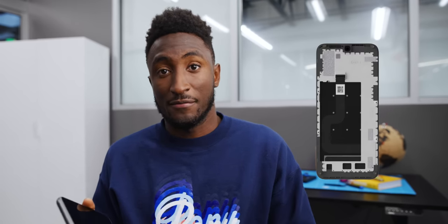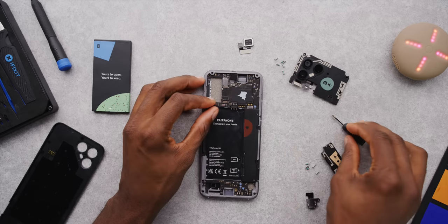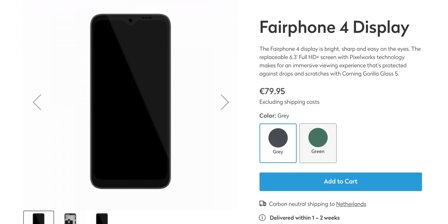It's not like other phones. These days in a normal smartphone, if one little part breaks, you have very limited options — whereas Fairphone envisions a future where anyone can identify something broken or something they want to upgrade and just do it themselves. That'll include your battery, rear-facing camera, front-facing camera, speaker, earpiece, USB port, and of course your display. The whole front display is easily removable with a single ribbon cable, and that replacement to the user is 80 euros — very easy to do yourself, unlike pretty much every other smartphone.